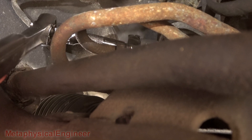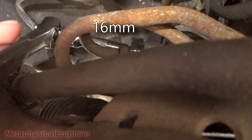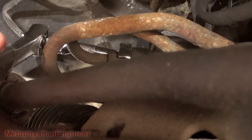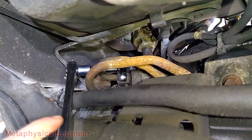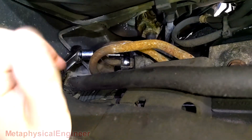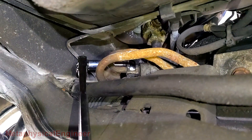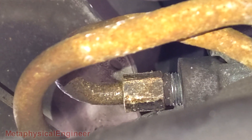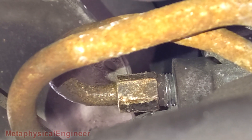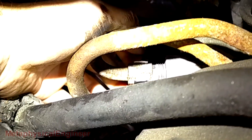This is one of those fun parts where it's almost impossible to get my face, the camera, and the light all in the right position at the same time. I have a 16mm crowfoot wrench on the upper high-pressure supply line. To my great surprise, I'm actually getting this thing to turn a little bit. The camcorder is a little bit too bulky to maneuver down here under the car. That nut is turning — I'll just have to work it off a fraction of a turn at a time so I don't bind up on any of the other lines. I'm going to take this chance to hit it with a wire brush and some brake cleaner, knock some of that grit off so it can't get inside the system. Got it cleaned up and finger tight — any time now this is going to start dripping. Got my catch pan at the ready.